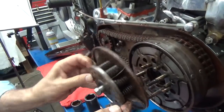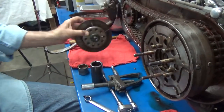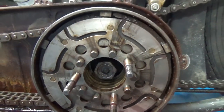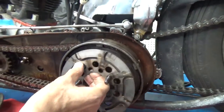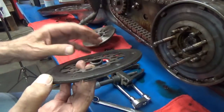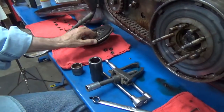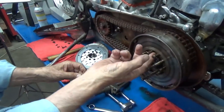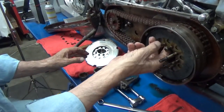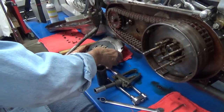That comes off as one piece like that because we put this washer right here. Now this is an early type clutch - this is called a half plate. There's fiber on one side and nothing on the other. That's the last one in when you're putting it together. What I'm finding is a bunch of really soaked, nasty stuff.